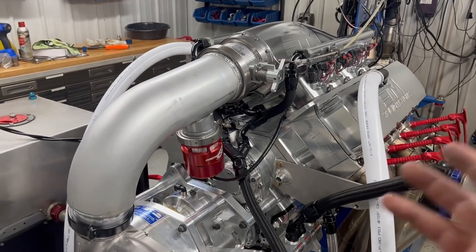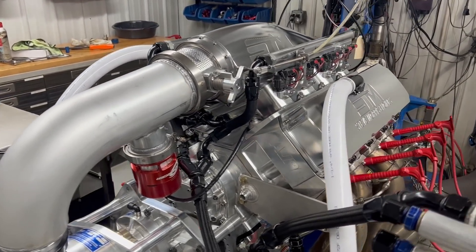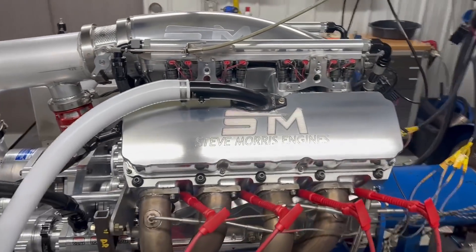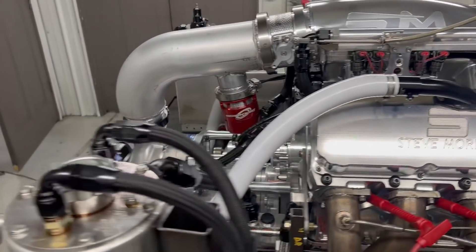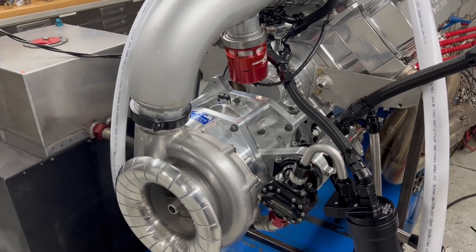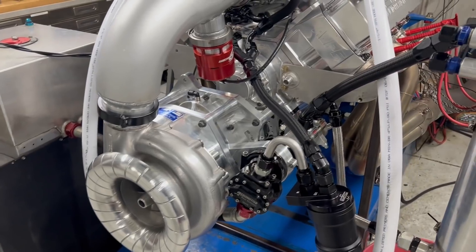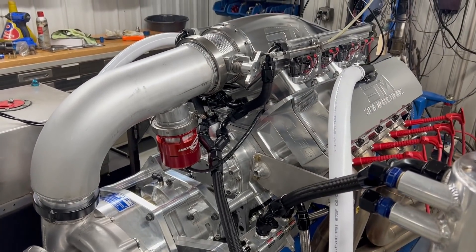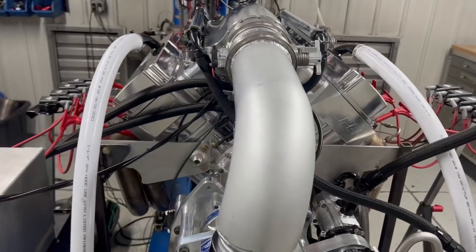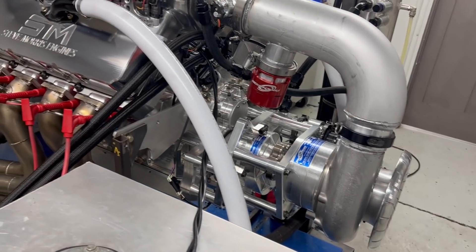It's got all of our normal goodies in it — the rotating assembly that we use in the SMX. This one happens to have the T&D valve train on it; I don't have the Mantons on this one. Gear-driven 136, so we don't have the great big blower on it. It's not the F4X 140 — this is a real deal 136 with our inlet bell. Obviously it's not going pro mod racing; just real fast, top sportsman type stuff. Really good solid piece.